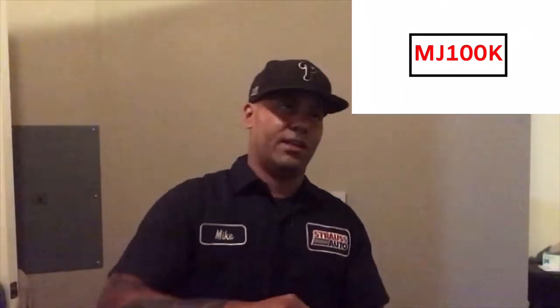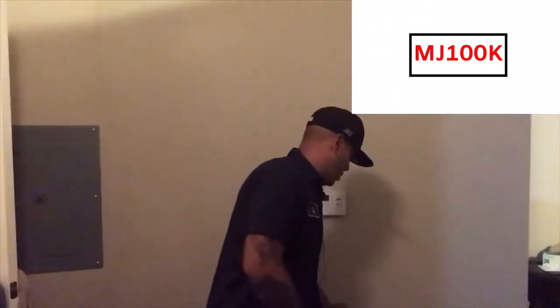So I would stick this in the vents, and then I would check to see if the AC's working right, and it's like, oh, it's only blowing out 80 degrees. And then you fix the air conditioning problem, and then you measure it again, like, all right, yeah, now it's blowing out 60 degrees. So yeah, I like this little temperature probe, that digital multimeter.